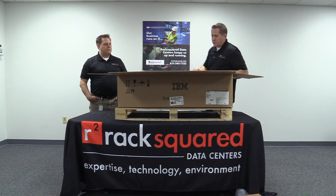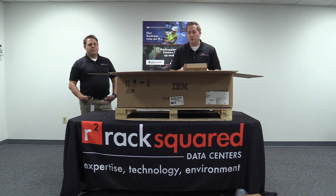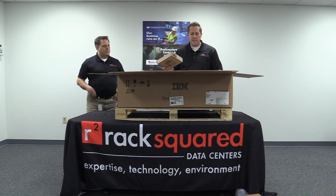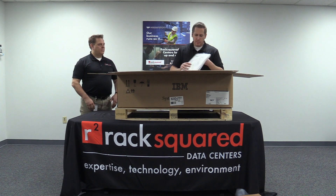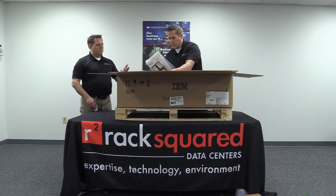This particular model, we did get some additional optics put in place for it. We're running fiber channel cards. We will be loading VIOS on this particular frame, so we have redundant fiber channel cards and redundant networking adapters. We are going to be using the 10/25 gig networking cards and 32 gig fiber channels.